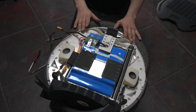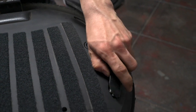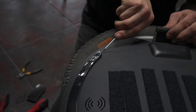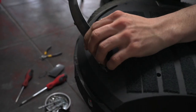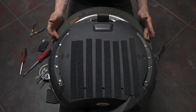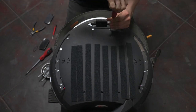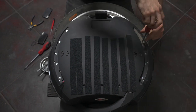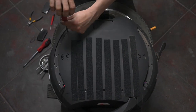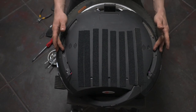Go ahead and flip our wheel back over and remove the LED strips on the other side and the side panel. Now let's remove all of our screws on this side — the five under each LED panel, the three up top which are normally under a piece of foam, and our two on the bottom also covered under a piece of foam. Now all of our screws are loose and removed. Let's remove the side panel.